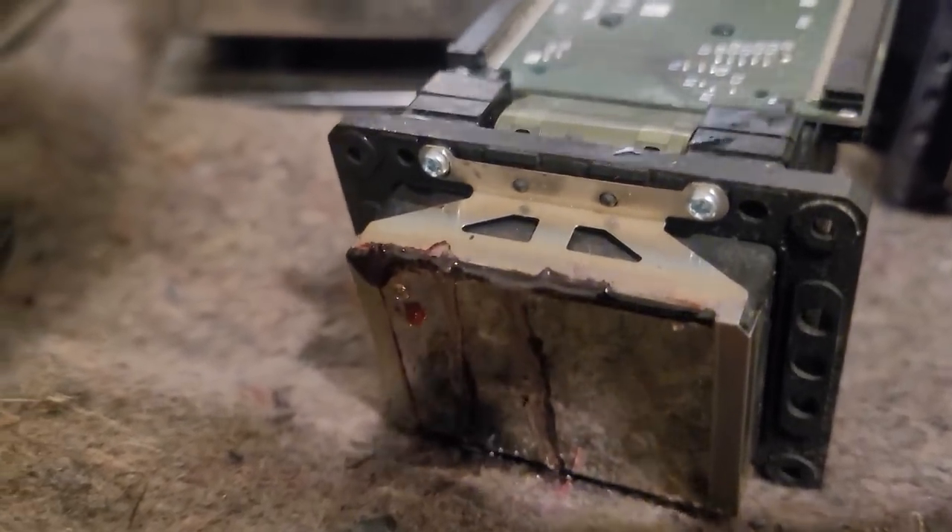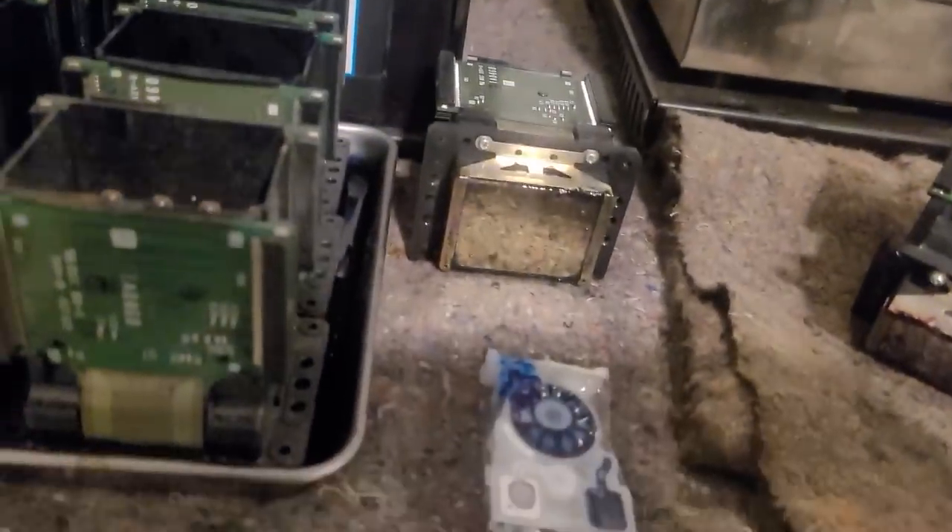The glue that's used — I actually have this glue and I have the patent information. It is a great glue, but with such a big nozzle surface, it's kind of hard to keep this sealed. For the majority, the problem lies within its capping and its cleaning. Typically, when it does its cleanings — which is normally to preserve the head — it's actually ruining the head. What happens is whenever it's capped, the capping station is putting a lot of pressure on this nozzle plate, flexing it back and forth, and it's doing its suction, which is sucking down this nozzle plate.